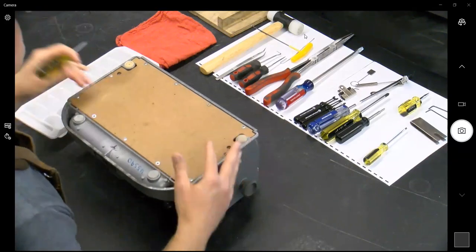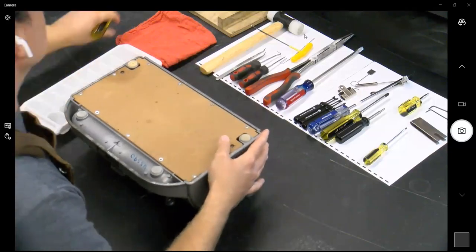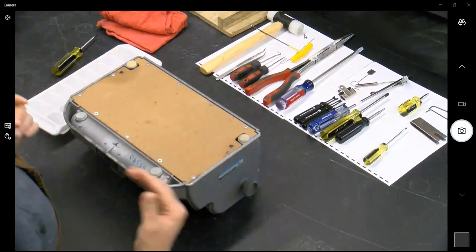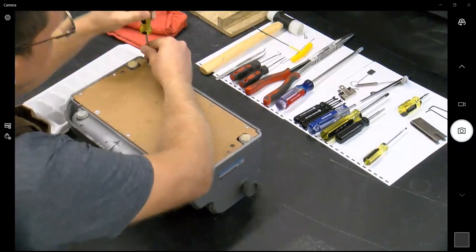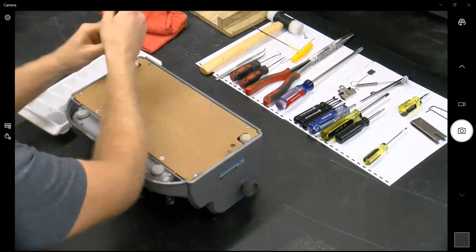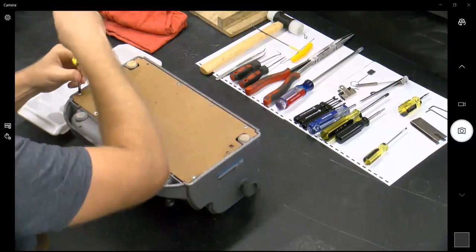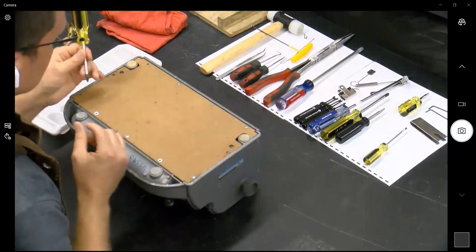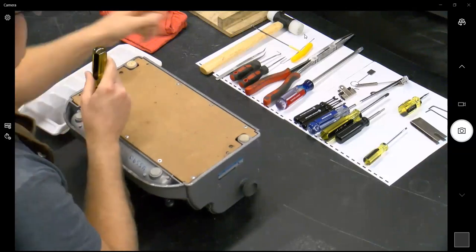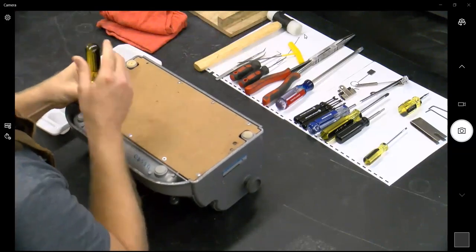Put all 11 screws into the closest compartment in your ice tray. The brailler may rock a little — you can use a towel to help, or use the cradle. We just take them off one at a time. Some of these may stick; if you get one that sticks, a little trick is to take a small mallet or hammer and just tap it gently — that sometimes helps loosen stuck screws.